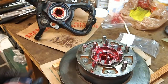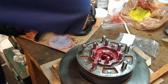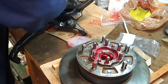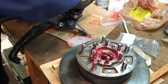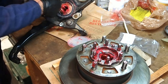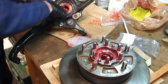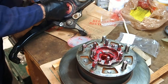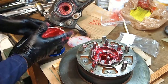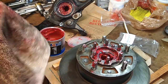Let's get some more grease in this stuff. I've been squishing it into those needle bearings. I'm gonna add it in there, come up in on your brass bushing and fill in the cavity a little bit. You don't want to go crazy here because the more grease you put on that, the harder you've got to pull on the front side to get the axle out so you can get a true measurement on that snap ring.